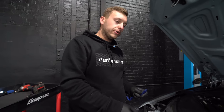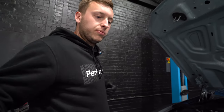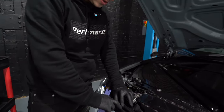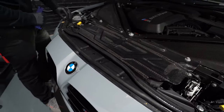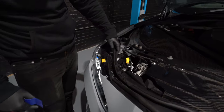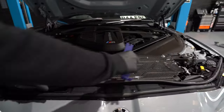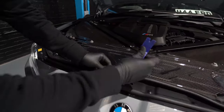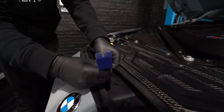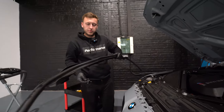Now we drop the car down. I always do the underneath stuff first, because you drop the car once, take the top off, pull the bumper off. Using your trim removal tool, there are push fixings — umbrella fixings — all along the top to remove this trim, as well as the rubber gasket from the lights. You don't need to remove it from this section. Pop these out and place that aside.